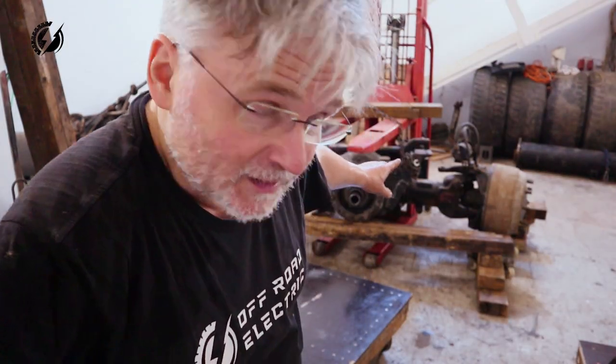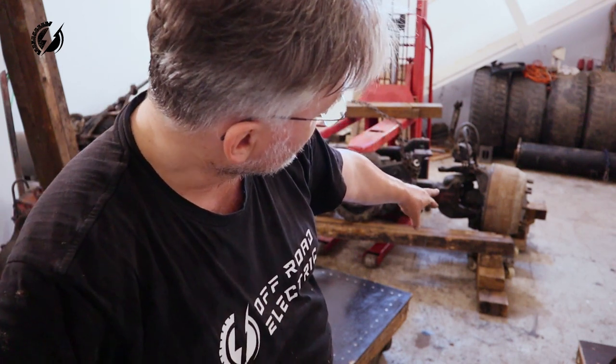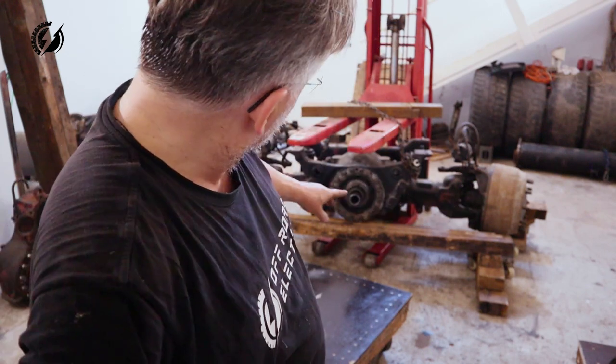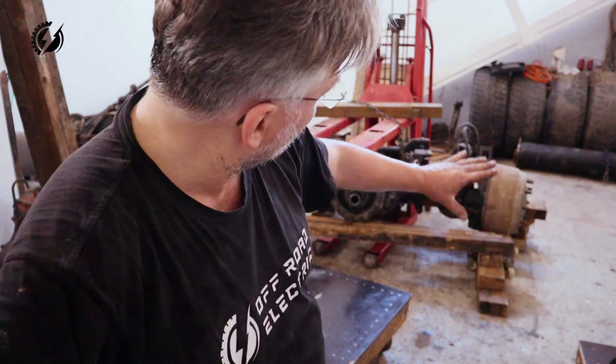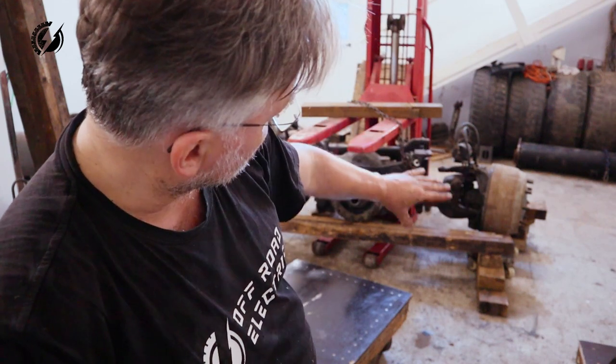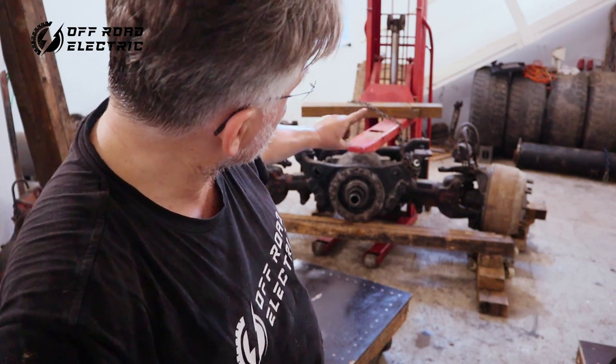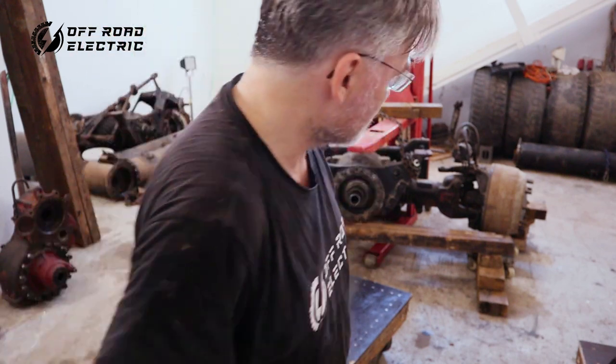This is so heavy that I am pretty much bending the stacker, so I had to put some wood under the wheels, on the caster wheels, on both sides, so the weight of the wheels and the half axles is deducted from the total weight, so the stacker can actually handle it.